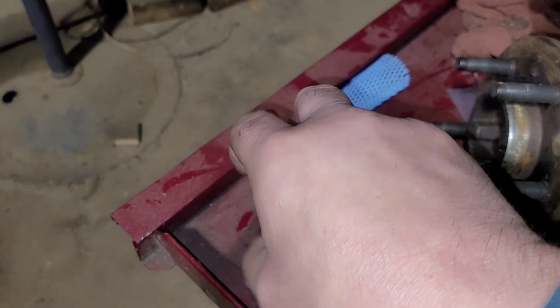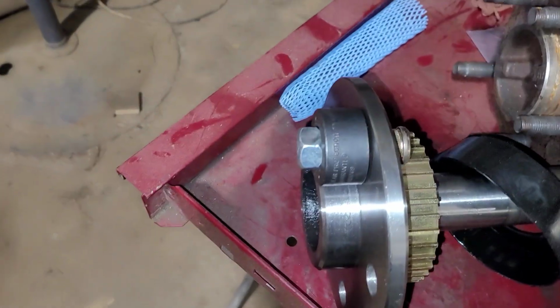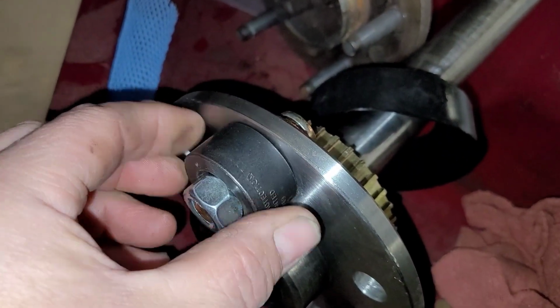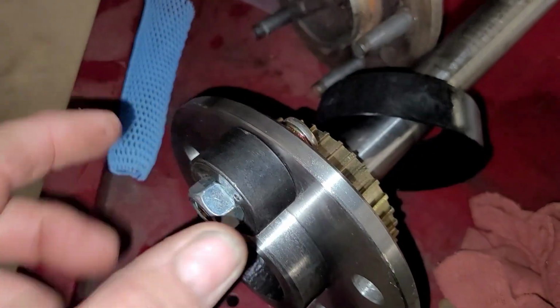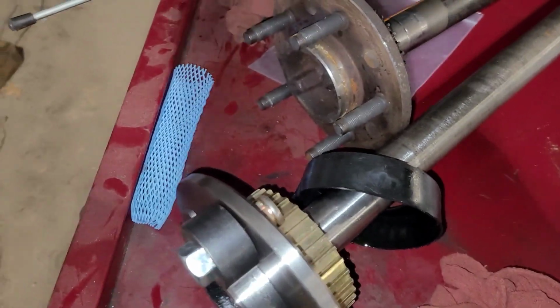But you can pick this tool up. I think pretty much every parts store carries them in their help section, or their tool section rather. So you thread the lug on like that, and then when you tighten the lug up, this is actually a roller bearing, like a throwout bearing. That will actually allow the bearing part to lock in here while the rest of this rotates. You don't gouge up the wheel stud or the wheel lug or even the hub flange there. All right, but I will show you that tomorrow.